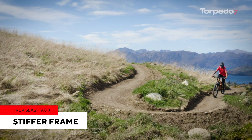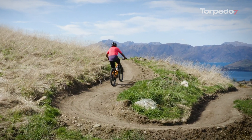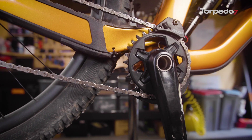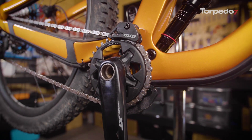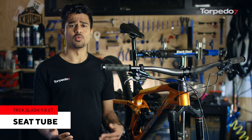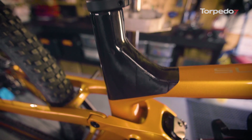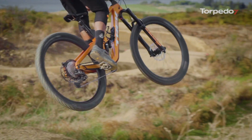Overall, this bike is slightly stiffer than its predecessor, which makes for a really responsive ride on any terrain and better performance on those long climbs. Another change for this year is the move to a standard BSA threaded bottom bracket, which any home mechanic will appreciate. For the seat tube, Trek has gone for a wider 34.9mm option. The seat tube insertion length has been increased too, allowing the use of longer travel dropper posts. The setup increases space for dropper post internals and boosts reliability and stiffness. This system works really smoothly and is a pleasure to use.